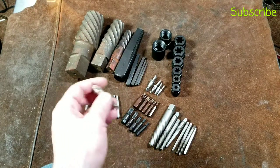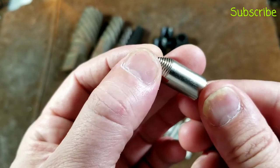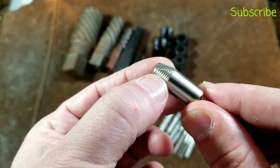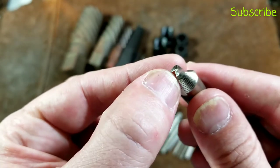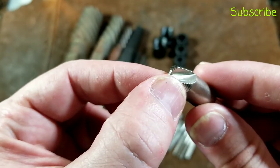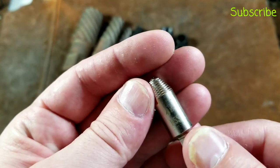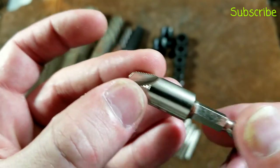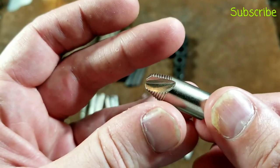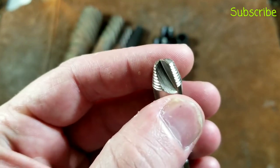The last few things: these are designed to be used in impact drivers. These are high-speed steel — I think these are Tectons. They don't really work so well cutting. The idea is they kind of cut and then eventually thread in and extract whatever fastener you're using. They have a flat tip, so it's really for trying to use on Phillips head screws, but it just hasn't worked out well for me. Where these work better is when you pre-drill — they do have a steep taper, and it's nice because you can use them in your impact driver. Once you start them, the impact driver will just hammer these out and either the whole thing will split open or it will unscrew. These are pretty common as soon as you search for impact extractors.